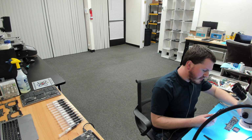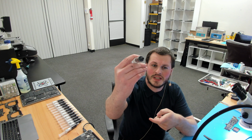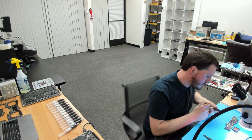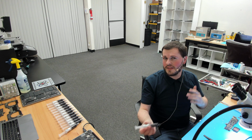So remember back when I did the test on the heatsink seal test? Let's go ahead and try with our thermal paste and see what difference it makes. And one thing to point out here, generally using more thermal compound on any of these devices that utilize a special type of paste is better than using too little. Our syringes have a specific size applicator on them, and it will not really allow you to put too little thermal paste on. Too much is generally not an issue, but too little can definitely be an issue.